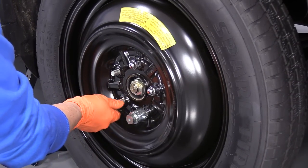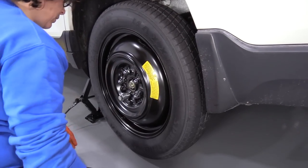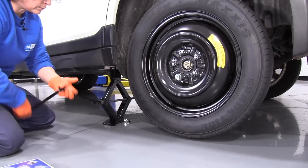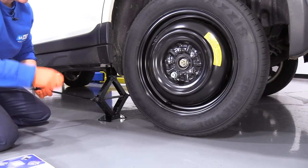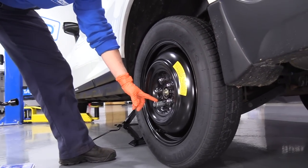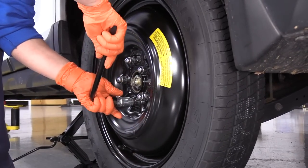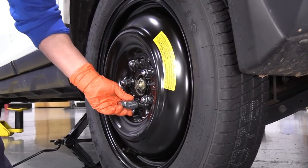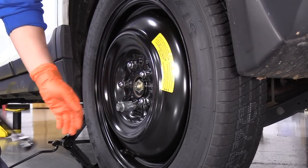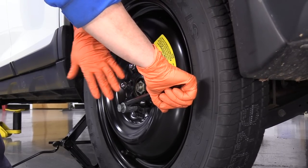Hopefully you don't have to do this at too fast a pace because of traffic — hopefully you feel safe enough and calm enough. Now they're all hand tight and I cannot tighten them further by hand. Now I'm going to come over to my jack and lower it counterclockwise, putting pressure on the tire — not the full weight of the vehicle, just enough pressure so that I can tighten those lug nuts. I take my lug wrench and start at the bottom. I like to start at the bottom to put pressure on that hub that way. Remember, this is a temporary repair, so you want it as tight as you can get it. I'm going to go in a crisscross pattern — even without an air gun, you do everything in that pattern so it hugs and pushes the rim into the hub equally.